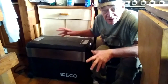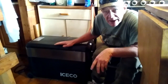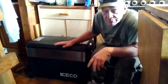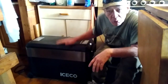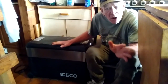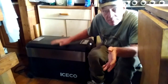Another great appliance is a micro portable fridge. This model runs off 12-volt, 24-volt, or 110 AC, and only pulls about 45 watts for a few minutes every hour — very low power use. In a blackout you can keep medications like insulin cold, or transfer food from your main fridge. I actually use two of these here at my cabin — one as a freezer and one as a fridge. Off a large power station, these will run for a week without draining the battery.